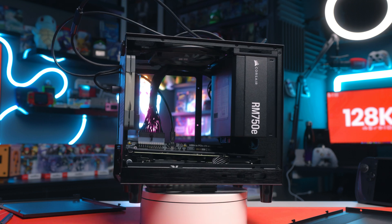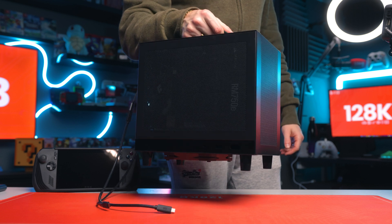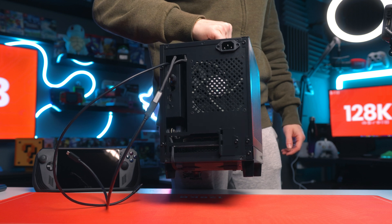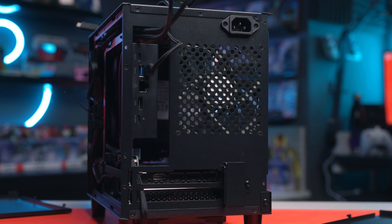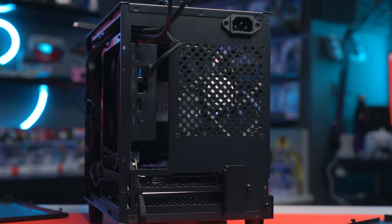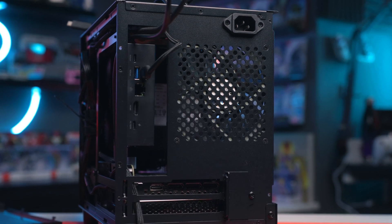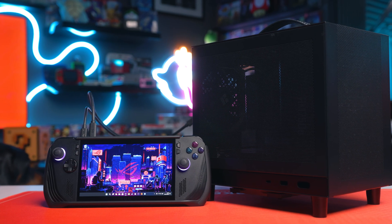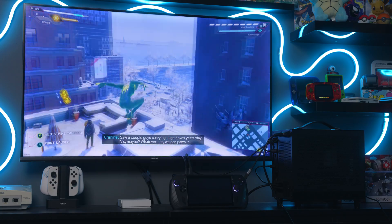The case has its own passthrough port for the power supply at the top, so there's a cable that runs through and plugs directly into the PSU — which is held upright at an angle. Make sure you turn the power supply on before mounting it because there's no way to get your fingers in there once it's assembled. One of my favorite things is that this case has a handle, making it a portable setup. All I've got to do is plug the kettle lead into the wall, the 100W power supply into the dock, and then just two cables — the UT3G eGPU cable into the USB 4 port and the dock cable into the other port on the Ally X.